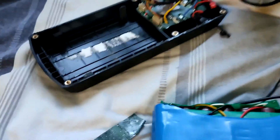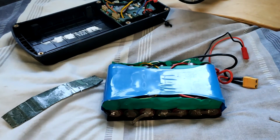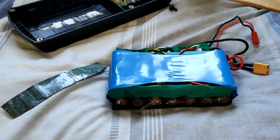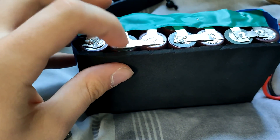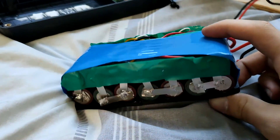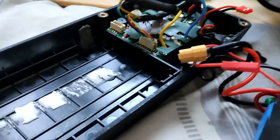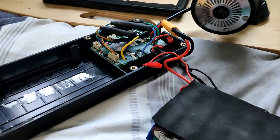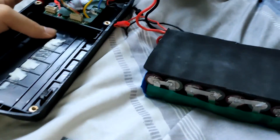Okay, so it's the third day of my new battery. I was riding down to Asda and went over a drain that was really bumpy, and then it just turned off. If I tried to turn it back on, it would just beep because there wasn't enough voltage. I managed to get it back home because I turned it on again and it worked. This one connector here wasn't attached, so I'm heating up my soldering iron now to connect it back up. While I'm here, I'm going to check the rest of the connections and make sure they're all still fine. I've just re-soldered the connector so now it's not popping off. I'm going to connect the battery up to the skateboard — yep, it's all working fine.